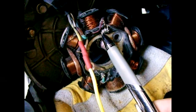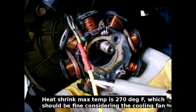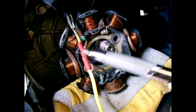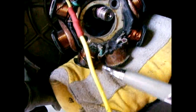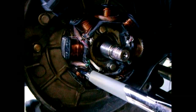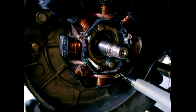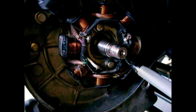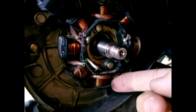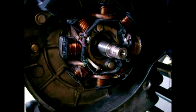I cut the yellow wire from this spot here and left everything intact. The yellow wire is going to be too short so you'll need to get another piece of wire to extend it. Solder the two together and then apply two layers of heat shrink before you wind it around the stator and solder it to the other wire right here. The stator is now bolted back in tight. The yellow wire is routed behind each one of these poles so it does not interfere with the flywheel as it's spinning. The wire that was located next to the ground wire has been cut and soldered to the yellow wire, which is pushed out of the way. This is very rigid — it's not going to go anywhere.